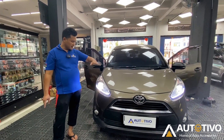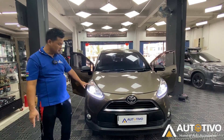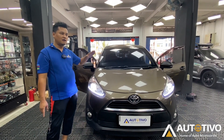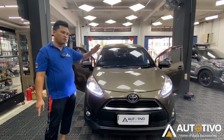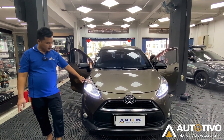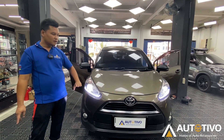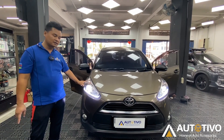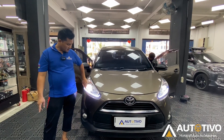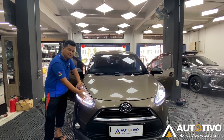To explain a little — this headlamp actually already has a projector built in, but it's still standard. So if you put in an LED with low wattage — there are many LEDs at 20W, 25W, 45W — I recommended to the owner to use 55W, because the standard halogen is also 55W. So no need to worry, we're not increasing the wattage since the standard is also 55W. The advantage of LED is that it doesn't get hot, whereas the standard halogen, even though it's less bright, runs hot because of its halogen nature. But this LED doesn't get hot.